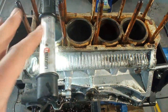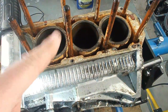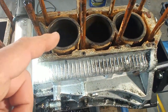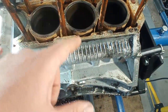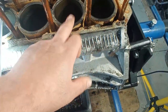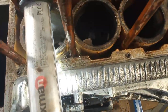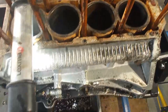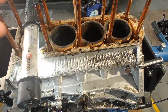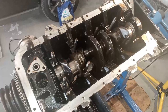I was starting to pack up my tools when I remembered I could do something about these liners to help whoever removes them — I don't have a press. As I showed on the Alfa 166 video, galvanic corrosion happens between two types of metals: here we have aluminum all around and steel liners, causing a lot of visible corrosion and corrosion on the studs as well. So I decided to pack everything with a lot of engine oil to make it easier, since the engine will be sitting here for weeks or months. I hope this will act on the corrosion and make things a little bit easier. See you next time, guys.